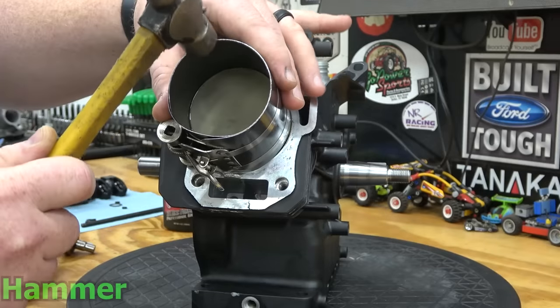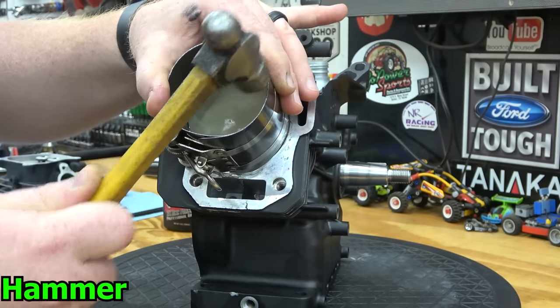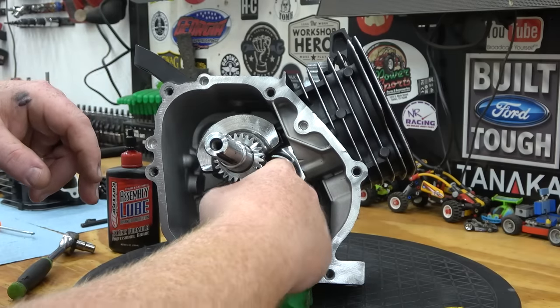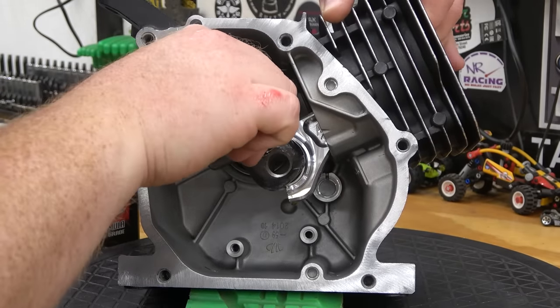Slide the piston into the block and seat the compressor against the block by tapping it with a hammer. Using the handle of a hammer, tap the piston out of the sleeve and into the block. Oil the bearings and install the rod cap while repeating the torque process used before.